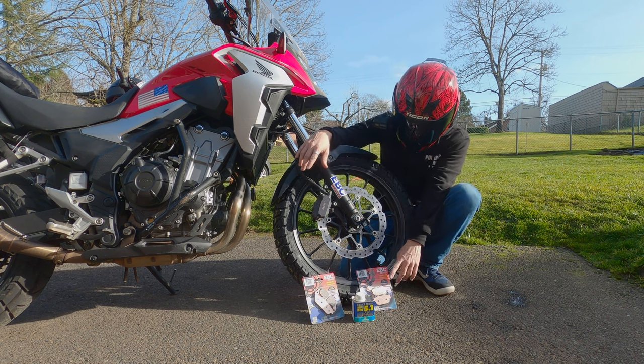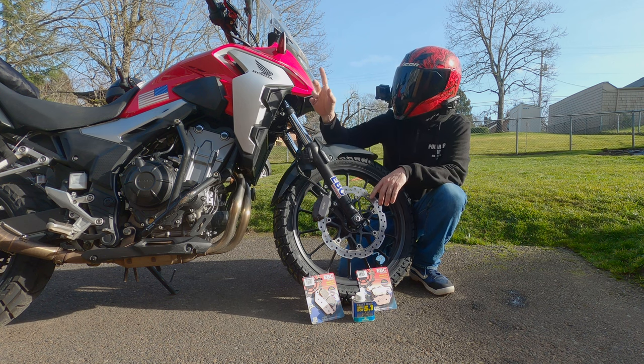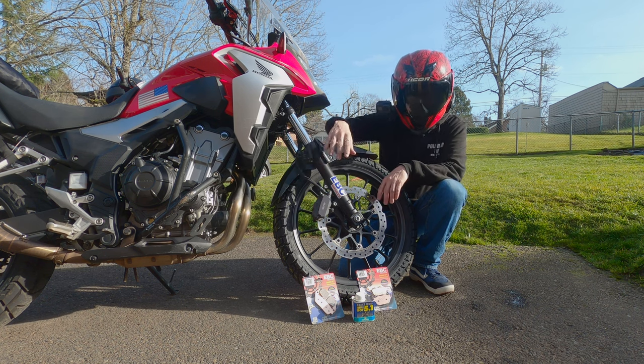brake pads. So I have EBC rear brake pads for the back, and we're going to bleed the brakes front and back. This was bled out with 5.1 when I did the EBC brake pads, but the rear, like I said, is all factory, so we're going to replace that fluid too. So let's jump into it, folks.